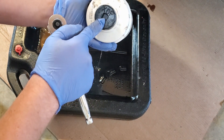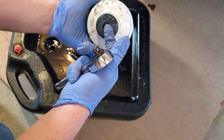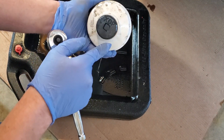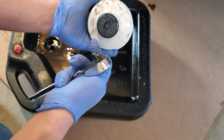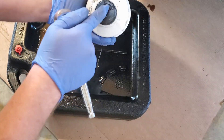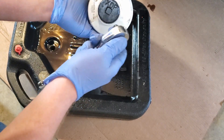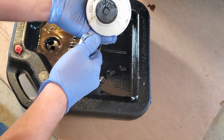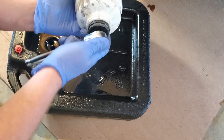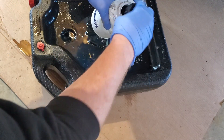Some of you guys are going to have a fuel water separator — it's going to be white with a little connector on it. Go ahead and remove that; be careful not to break it. Use a vice grip of some sort. Don't break it because it is a dealer-only part. I bought this XDP delete plug — I'll put a link in the description. It's aluminum and you don't need that sensor. Mine was not even connected. Go ahead and remove it.